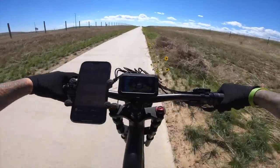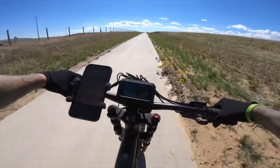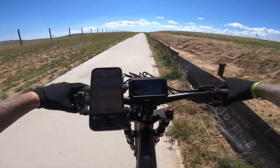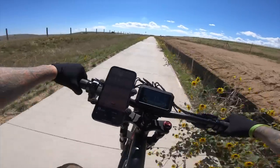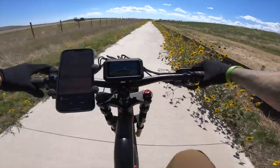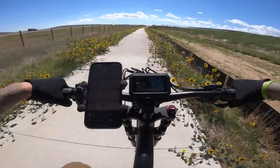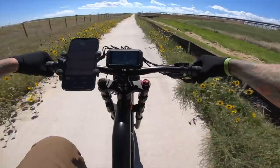Like I mentioned, I can customize these pedal assist levels — I'd actually turn up the power of the lower modes because I'm a little lazy. Modes 4 and 5 are where we get the biggest bumps — I'm barely pedaling and we're still cruising along. And now in pedal assist mode 5, if I put in even a little bit of effort, this bike really wants to take off. A torque sensor on a heavier bike like this is a really great move — they're generally less laggy than a cadence sensor, so when I stop pedaling it feels like the assist isn't even on.